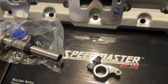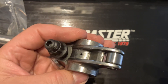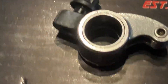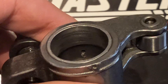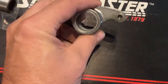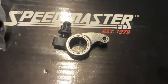It's more than I care for on a brand new set of rockers. I don't like these — I don't like the amount of play they have. They drilled an oil feed hole, which is nice — it's going to splash oil out to your roller. That's a nice feature. Until you get in there and you see that hunk of metal. That's the metal where they ran their drill bit through and didn't bother cleaning it. That's going to get inside there and score the shaft and scratch everything up. If it gets in your bearing, you're going to increase your clearance on that bronze bushing, score the shaft, and then you'll start leaking oil out of the side, which could lead to a loss in oil pressure.